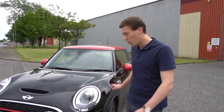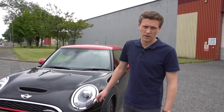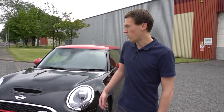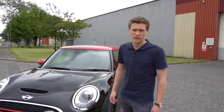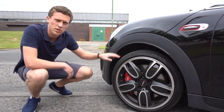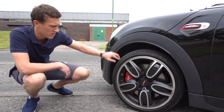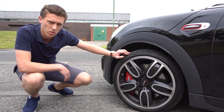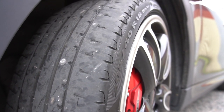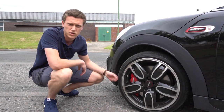The time has come because the fronts are now well and truly worn out. I will be in the next couple of weeks getting some Michelin Pilot Sport 4s fitted on all four corners. One of the main bits that wears down on the tyre is actually the shoulder, and that's because essentially when you corner, this is the bit that rolls over with the sidewall into the turns. As you can see from the shots, the shoulder is pretty worn out at this point. The actual tread depth is okay for now, I've still got a few weeks left, but they're definitely due for replacement.